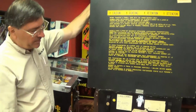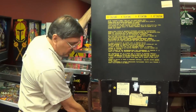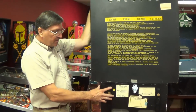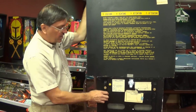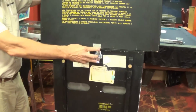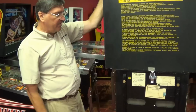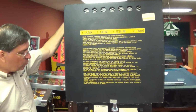There's a latch on the back. Two things about the latch. When you take it off, if you leave it like this and you do the moving of the cabinet job like we showed you, back pivoted down on the furniture glides, the manufacturers made these rails, but it's not enough to keep this from getting bent, even if you position it, because it will open up. Some people will tape it down, but if you tape it down, it's still going to ruin it. You want to take it off.